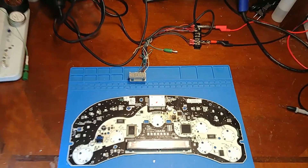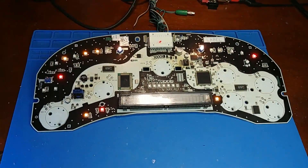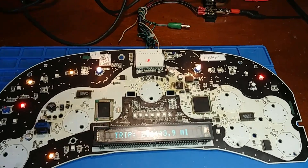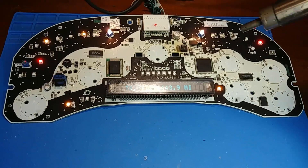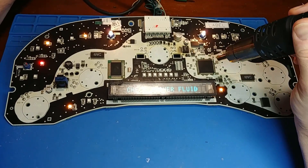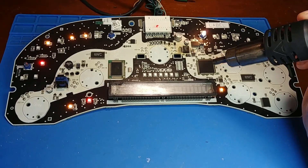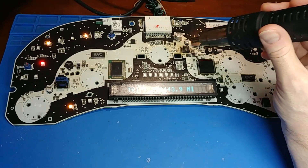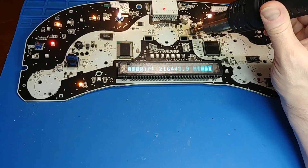We're back from the freezer. Let's do the cold test and make sure it still boots up okay — and it does. That's good. Let's give it the hot test. Fire up the hot air station and just heat it up. Blower up all the way. I'm going to reboot it a few times in the meantime just to make sure. When you see it reboot and start up, that's just me killing the power and reapplying it to make sure it still boots up normally.